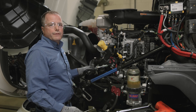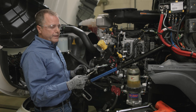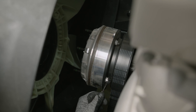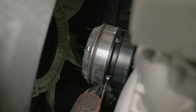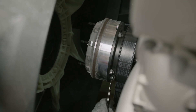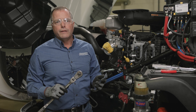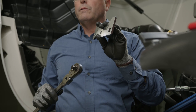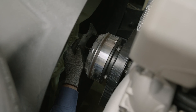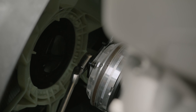The next step is removing the four nuts on the back of the clutch pack. To do that I have a 13-millimeter line wrench and a dead blow hammer. It can be difficult to turn the clutch pack to get all four nuts off, so I like to use a tool that Horton provides — it's a fan mounting friction disk removal tool. You put that on the fan studs and then use a ratchet to help turn it around so you can get access to the other nuts.